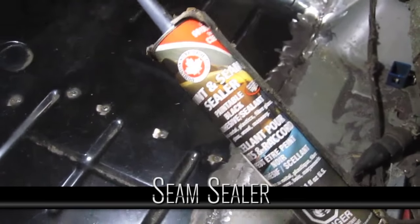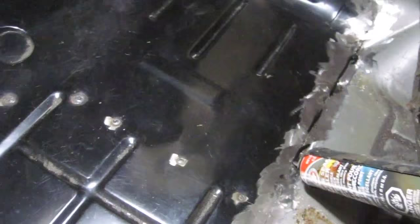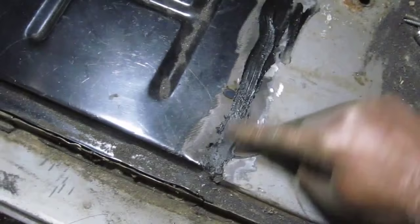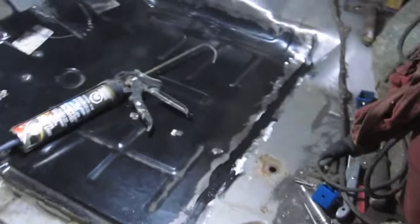Starting to look much better. I'll use the flapper wheel — I'll grab a brand new one. That's with the 40 grit; we'll go over again with 80 grit — starting to look much nicer. To finish it off we're just going to use a seam sealer — just put a light coat over top of the weld. It's paintable and sandable. Just a tiny little piece, spread it out, cover any imperfections, seal it, and keep the moisture out to keep it from rotting. I definitely want to do along the side too, just on the top here — you can see that's factory, they do the same thing. Once it dries we'll paint it — should be good as new, better than new.